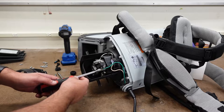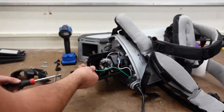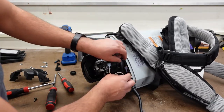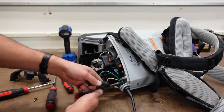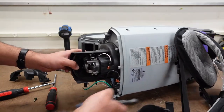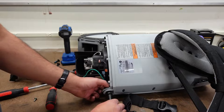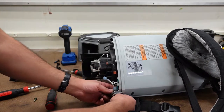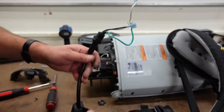So this is fairly simple. I'm going to pull off our ground using this 5/16th driver. With that out, you're just going to disconnect this white wire and this black wire. Now grab some pliers — channel locks, your preference — and you're going to unscrew that. It's a plastic nut. Slip that off and then slide each wire out one by one. And there's the switch.